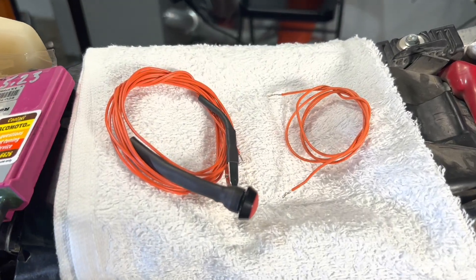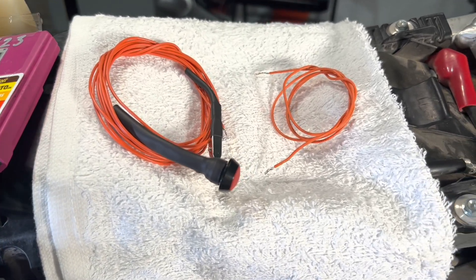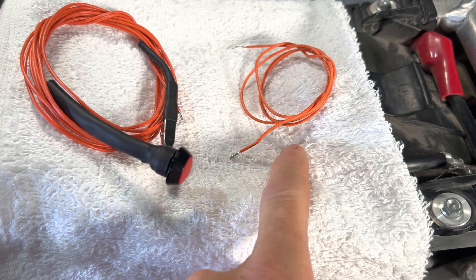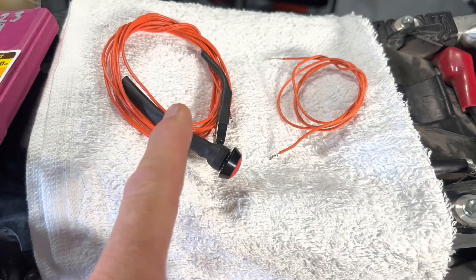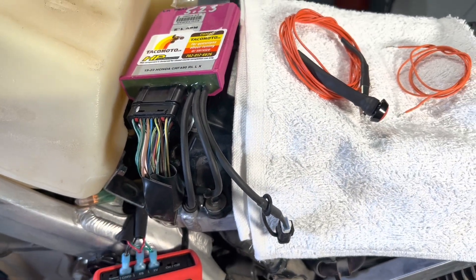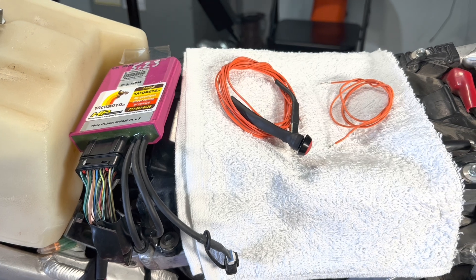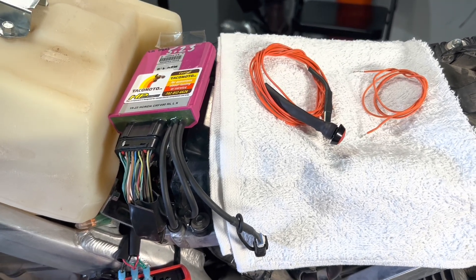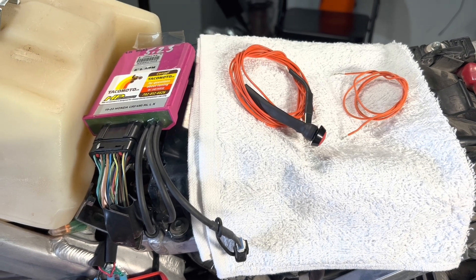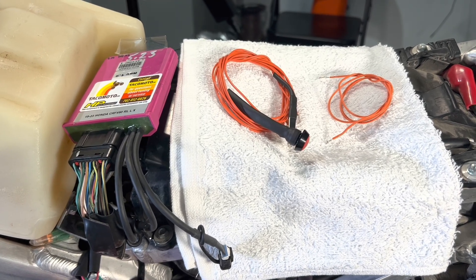The final part of this video is a quick overview of the idea behind TPS calibration. Who needs to do this? Some symptoms of a TPS that's out of calibration would be: difficult starting or no starting, rough idle, hunting idle, high idle, hesitation, misfires or feels-like-a-misfire, and erratic pulsing power delivery at low throttle angles.